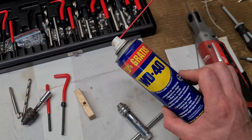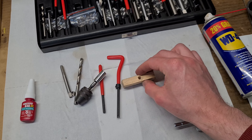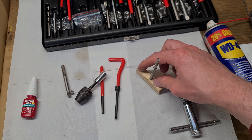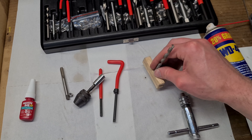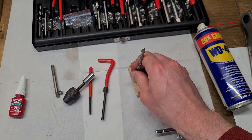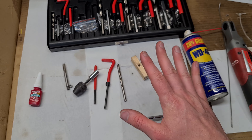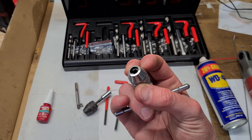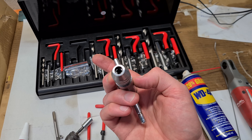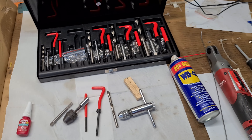To help lubricate I have WD-40, and I've made a piece of wood drilled with this same drill bit — it's basically an alignment guide. I'll place it onto the cylinder head and drill through that hole so the new hole stays nicely centered, ensuring the thread insert goes in along the same line as the original. I also plan to use my thread tap with a ratcheting attachment tool.